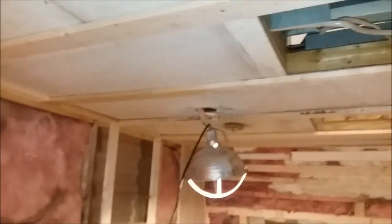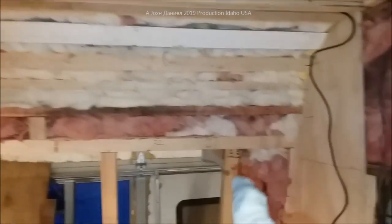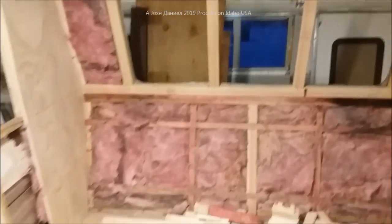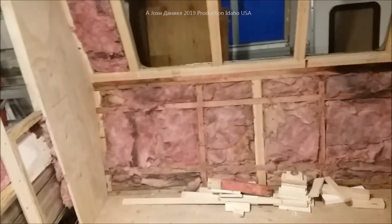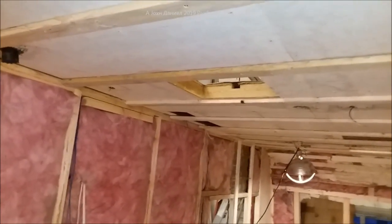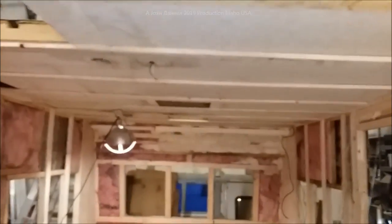But everything is coming along as far as the frame out, and I had to put a little bit of 1/4 inch furring material to get my plywood curve that will go in there for my paneling. But from right here in the middle of this header going down will be Luan, the 1/4 inch. So will the front, 1/4 inch or 3/8. We want to make it stout so we have things to mount for cabinets and things. The rest of this is in the process, and we have come a long way to getting it completely framed back up. A lot of new wood in it, and it is so stout now that when you get up on the roof, you could jump on the roof and this thing doesn't move at all. So big improvement, big improvement.